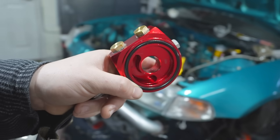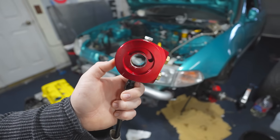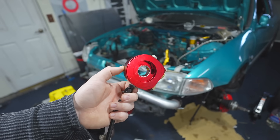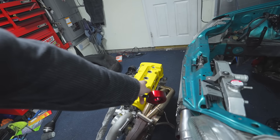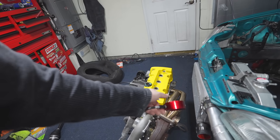Not only was this the reason for the low oil pressure, but this is where all the metal came from as well. Typically when a motor gets low oil pressure and you start wearing through metals, your oil looks glittery with really fine metal — you don't find burrs. We're finding legitimate burrs, and they were only in the oil filter. We didn't see any in the head or the pan — just silicone and paint flaking off the pan. So we're not going to run this sandwich plate adapter anymore. I bought an actual tap that taps off of the oil pressure sensor port, so we'll still have the oil pressure sensor and tap the feed off of that.